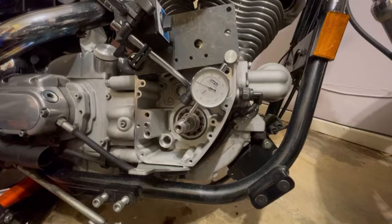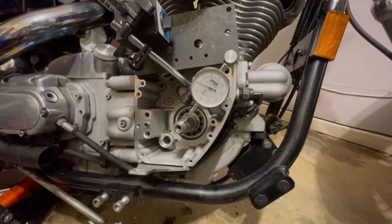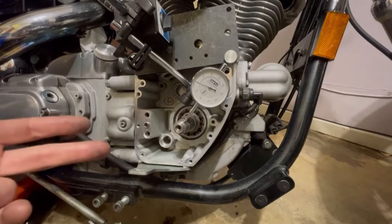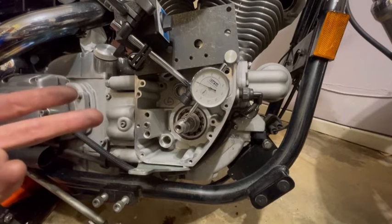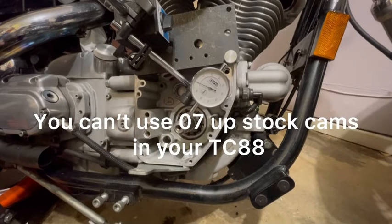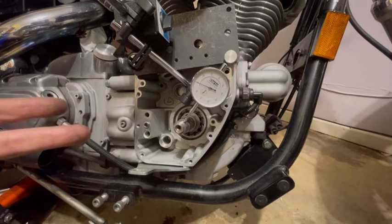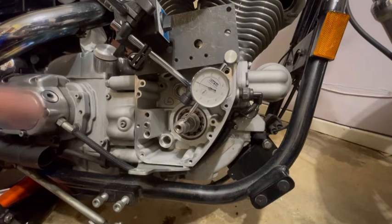Over five thousandths, you might want to think about just upgrading to the 07-up stock system — stock cam plates, stock pump, tensioners. You'll need a set of conversion cams because the inner bearings from 2007 are different. The reason is that the stock system has higher tolerances, while the high pressure systems like Screaming Eagle, Fueling, and S&S have lower tolerances.